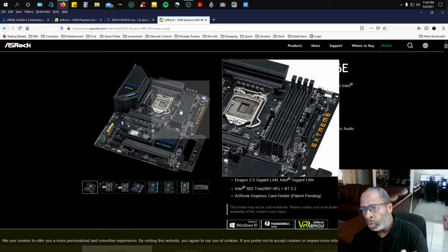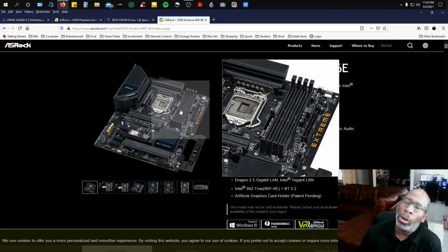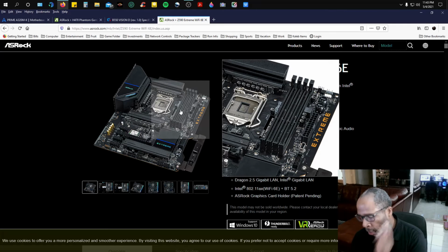If you want to go SSDs, it holds 6 SSDs. In the 3.5 spin drive bay, you need to buy a 2.5 to 3.5 drive bay connector. Install your 2.5 drives, slide them into the 3.5 bay, and screw them in. You've got two on the back and two on the inside. That's 6, and that's why I chose those cases. The more hard drives it holds, the better. Why? Because externals do not exist anymore.